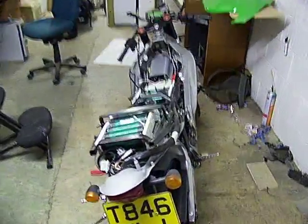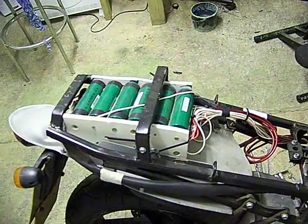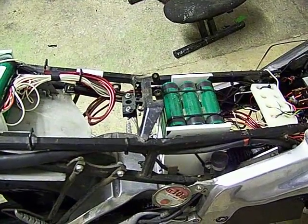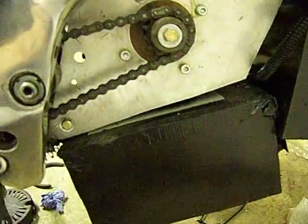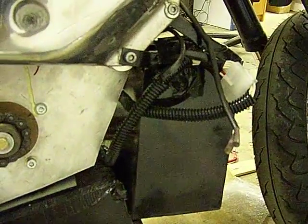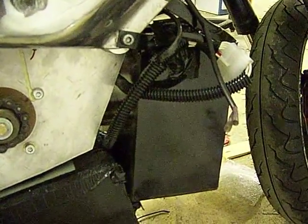Although it's mighty messy, here's a quick look around the Aprilia. You can see these two blocks of green cells here are the LiFeBatts — 10 amp hours and 80 volts, or 72 volts whilst running, for those two blocks there. Underneath there's another 72 volt pack and another at the front, each providing 10 amp hours. The one at the front is actually comprised of A123 cells, being slightly nippier than the LiFeBatts.